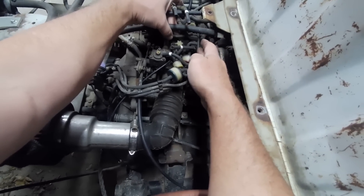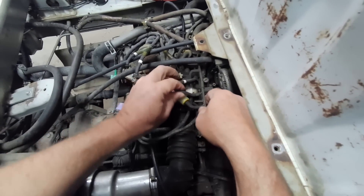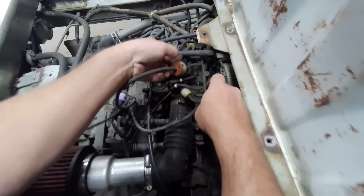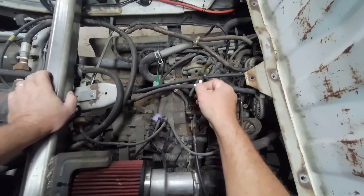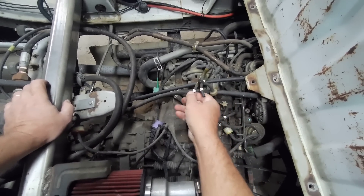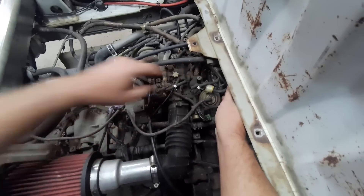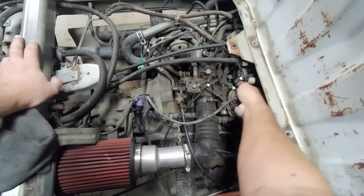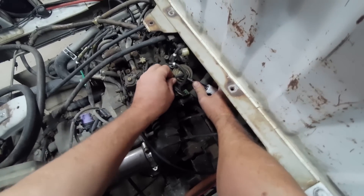Atmospheric is two. This goes to the choke — I'll put a C on that for choke. Finally found a manifold. This one's a manifold and it runs on this upper — I'll just leave that off for now. That's manifold, that's manifold, this is also manifold. For being a '91, these hoses are amazingly in good shape — it's crazy. It's also manifold, because it's off the opposite side. That's a solenoid — apparently it's like a choke idle up or something. Will not be needed. You better run good, Minnie. Now do you see why I'm waiting?